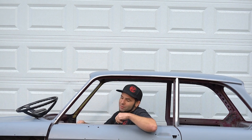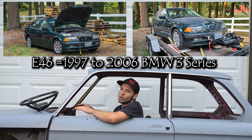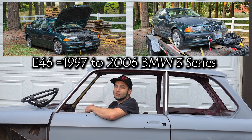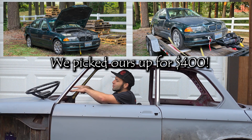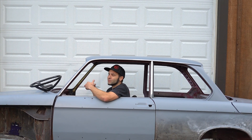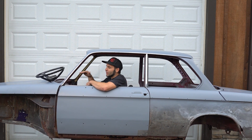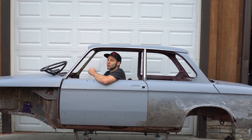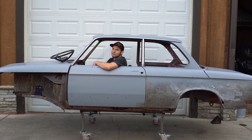After that, we're going to use these laser beams to align our E46 subframe. That's going to allow us to put 30 years more modern suspension into this car than it was originally manufactured with, so it handles better. We're putting custom in-house developed top hats with full camber and caster adjustment, tailored to fit coilovers that are way newer than E46. You're not going to want to miss the reveal — check out the process and learn as we go.